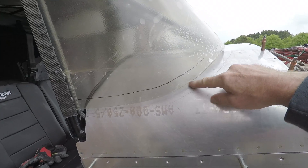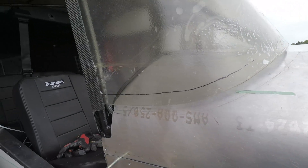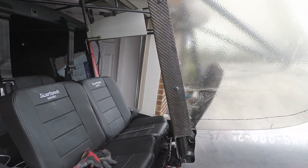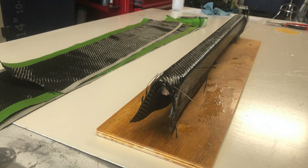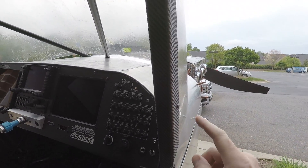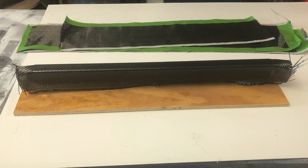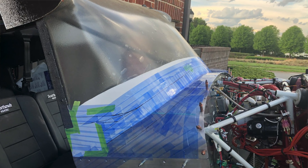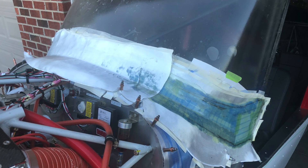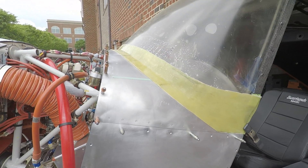Here's a better look at the gap I created by cutting this windshield too short. I also had to create covers for the pillar — I made these out of carbon fiber, just squared them off. I needed to do that before laying the fiberglass down for the windshield fairing, so I did that first, then laid down the fiberglass for the windshield fairing.